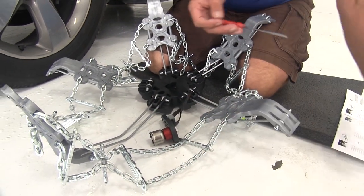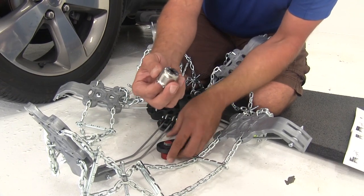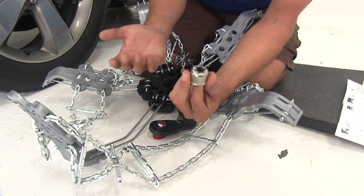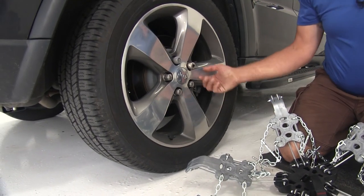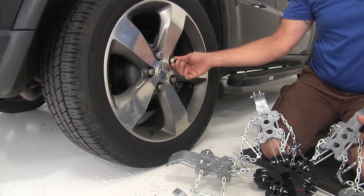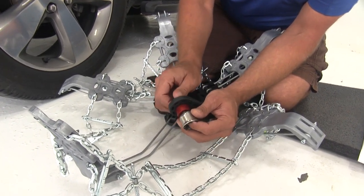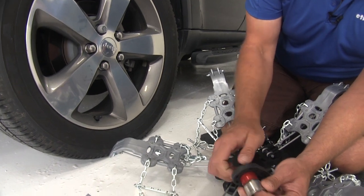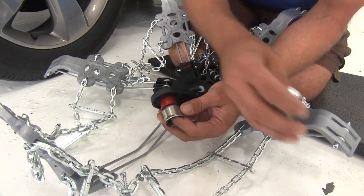Next, find the proper cup and anchor that fits over your lug nut. On the end of each adapter it says 21/22, 19, or 17 - that's in reference to millimeters. You want to find the one that will easily slide over your lug nut but that you can't turn - not too big, not too small. We're using the red anodized spacer, and we'll show you how you might need to add a single or double insert depending on how your wheel is set up.